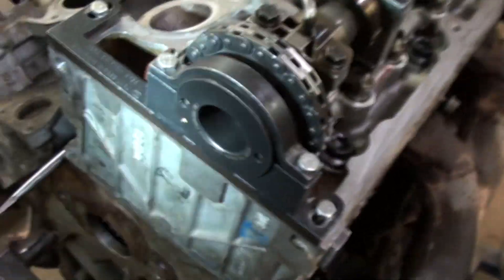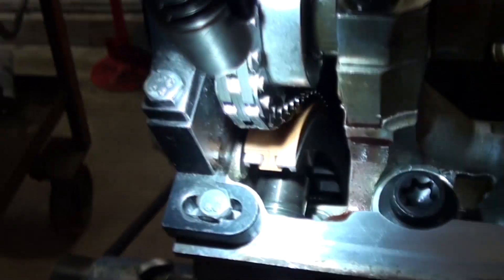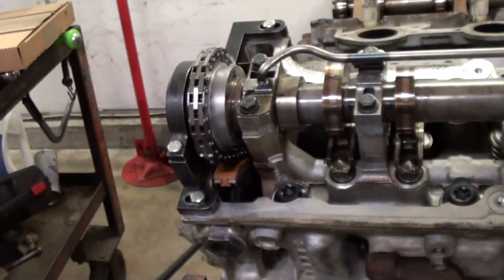Over here — this is the right-hand side, this is on the back of the engine. So if this timing set goes out, you can see the new timing components down in there — basically what they call the cassette, which is your guides, your chain, your sprockets — it's all down in there. My timing tool is still in there, hold on a minute, we'll be right back.